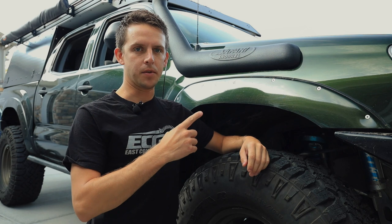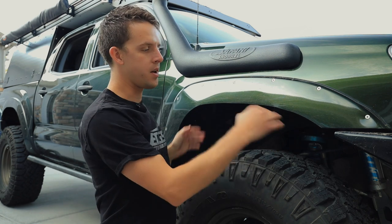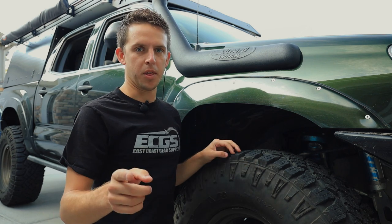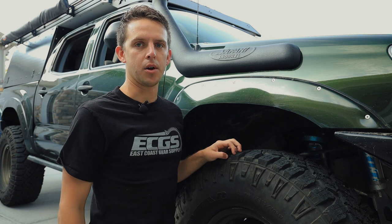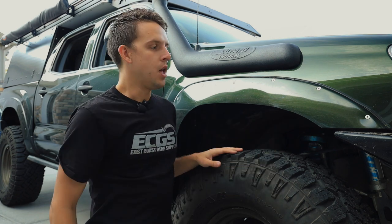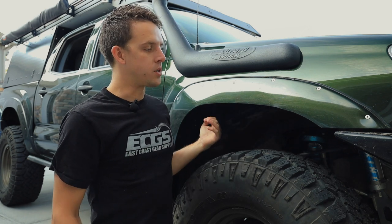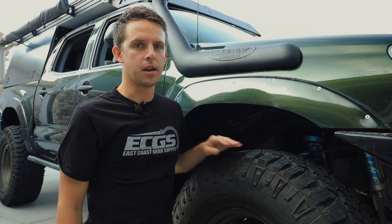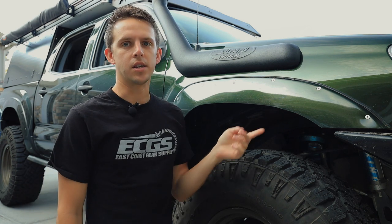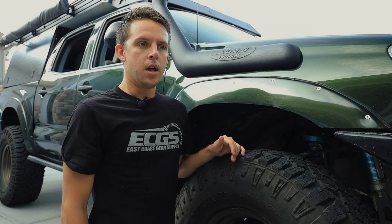The reason that I have the snorkel, which I hate the way it looks, is because when I was trimming the fenders as one of the many steps to fit 35-inch tires, by the way, if you want a video on that, comment below. Anyway, after I trimmed the fenders, I lost the wheel well liner, and the intake was right above the wheel well liner, right up in here. So the tires were just throwing things into the intake, you know, sand, rocks, mud, salt, all kinds of stuff, just straight into the intake. So I rerouted it up there with the snorkel.